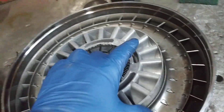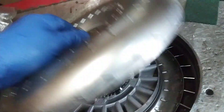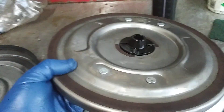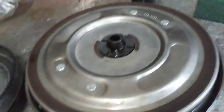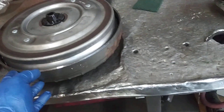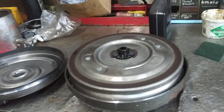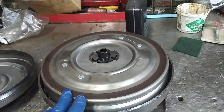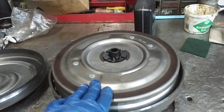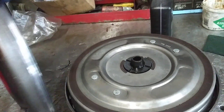I'm not going to get into a lot of detail on how torque converters work — there are a lot of videos on that. Basically it's a hydraulically operated unit that takes one set of fins and throws fluid to another set of fins. When you get up to about 35 or 40 miles an hour, this clutch is applied hydraulically to this plate, which is bolted to the engine — that's torque converter clutch lockup.